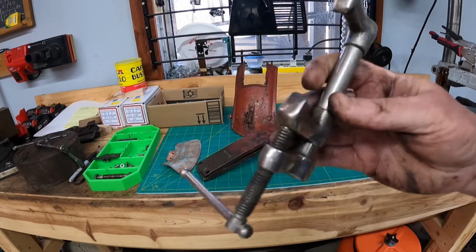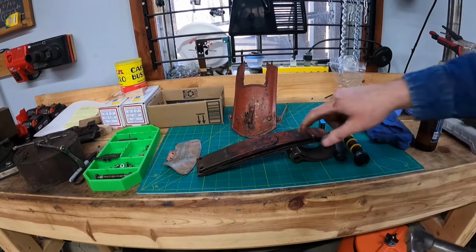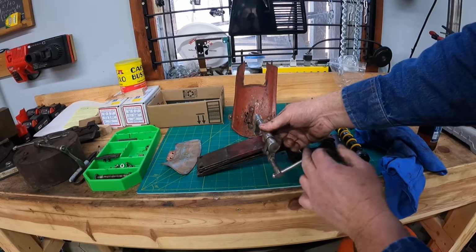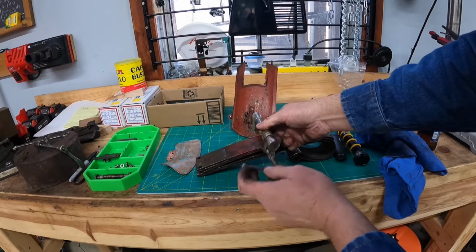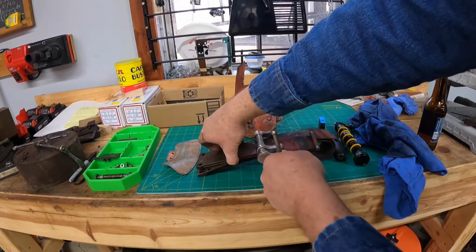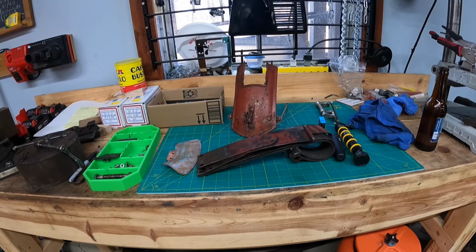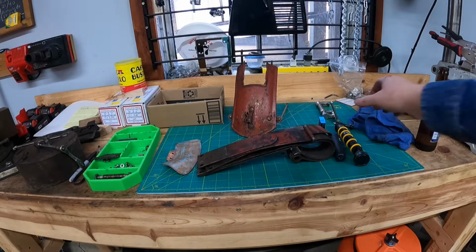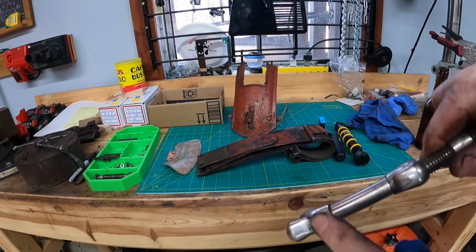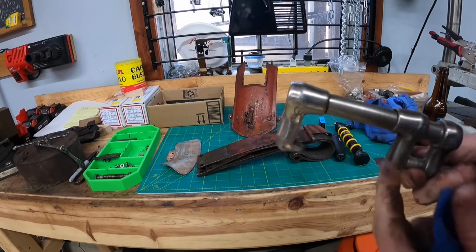So, guess what that does? When this spring pack is all mounted up on your front suspension, you can't oil or grease between the leaves, right? And so they'll start to squeak. So this little tool you put right on there, and it's got these little wedges, right? And you tighten it up like a clamp, and it wedges those apart, and then you can lubricate them. You can get some grease or oil or something in between them so they don't squeak, so they slide. So I should probably do that in my cool old tools series, but that's what that is. Looks like it was hardly ever used. You can see it was used because there's a little nickel gone right there, and maybe some little dents right there, but for the bulk of it, the nickel's intact. Looks really good.